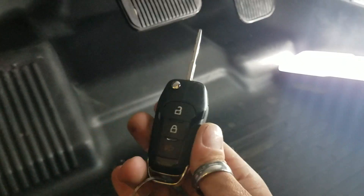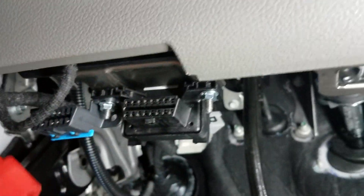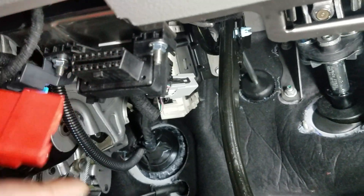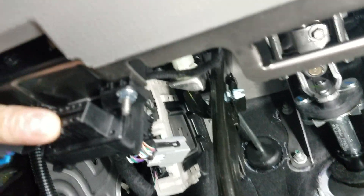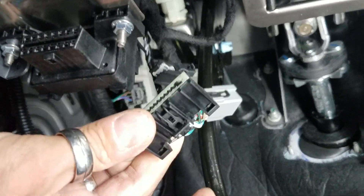So we're going to show you — 2017 F-150 we got. Obviously it's an XL, so it's got a key, no push button. Our OBD2 connector is this one right here. This one actually has two — it has this right here. This vehicle has been converted to natural gas, so this is the programmer for it. I'm going to push it out of the way for a second so I can show you this install. Behind the OBD2 connector there is a little oblong-looking 24-pin plug.